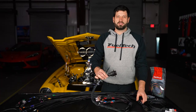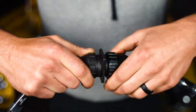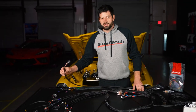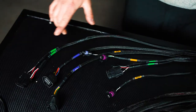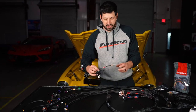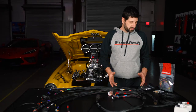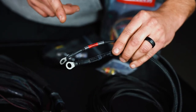We have a nice CPC connector that goes through the firewall, making for a very clean installation — one side goes inside the car, one side goes outside. You just unscrew it and take the whole harness away. It already comes with provisions for two nanos, two O2 sensors, engine temp, oil pressure sensor, fuel pressure sensor, transmission temperature, crank signal VR and hall, and cam sync VR and hall. We also have a CAN bus ready to go, and if you want to add EGT, it's already there. Just two wires to battery positive and ground, plus a key-hot, and you're ready to go.